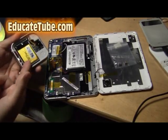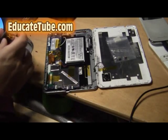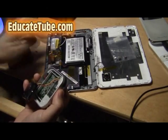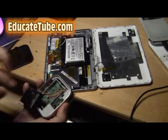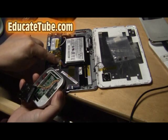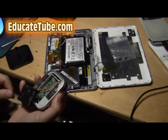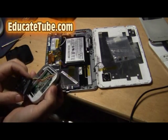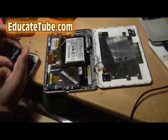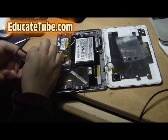There's a battery in here. We are going to remove that battery. Instead, we are going to wire it to this battery here. Let's remove this battery. You see these wires — it's the exact same color except for the blue one; we replaced it with a yellow wire. So we're going to cut the wire here and open up the wiring so that I can just solder in or roll it in. Let's cut it about here — I want it as long as possible.